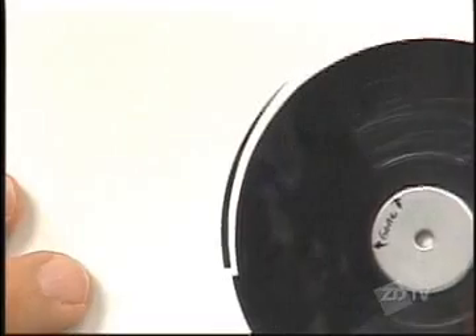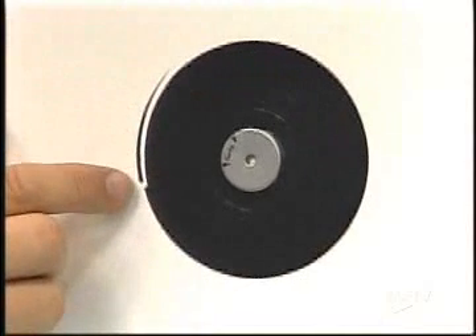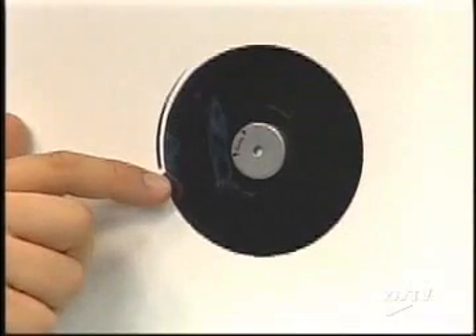There are two things that happen. One is that every time the heads are loaded into the cartridge, on some drives, they nick the disk itself. This is a large nick — more than a nick. That's a whole strip of mylar that was stripped off there. In the first show, you referred to these as typhoid Marys. In fact, this cartridge killed three drives one after the other. After it didn't work the first time, he took it out, stuck it into a different one, and it takes the heads right off of the drive. The mechanism was: he had one bad drive, stuck this good disk into it, sliced it — sliced off this piece — so he had this little notch. And that beheaded the drive. It literally pulled the read-write heads off. Two more drives. He put it into another drive, and a third drive. It killed them all. So this notch hits the head, bends it, shears it off — and then they're like hanging by their wires.